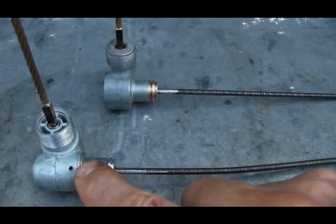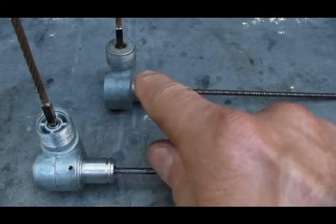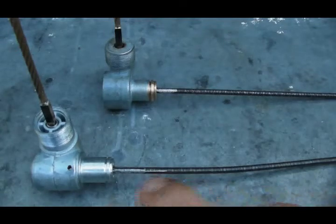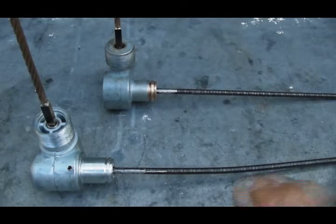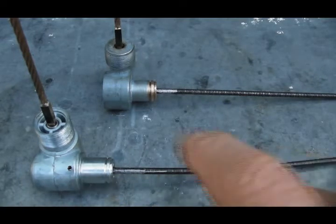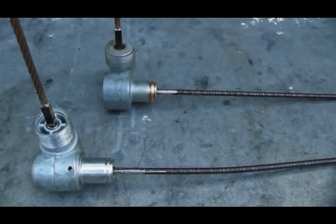He needs to extract the gear, and you can't take it out of the back of the housing on this one — so he cuts the end off and takes the gear out of the front. If you open the original, you take the gear out of the back. You can also see that this drive is much wider than the original. These drives sit about three-eighths of an inch closer to the suspension spring, and some owners have reported the suspension spring impacting the rear of the unit and breaking it off. The original drive gives you three-eighths of an inch additional clearance.